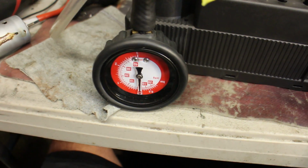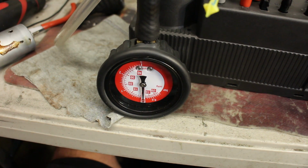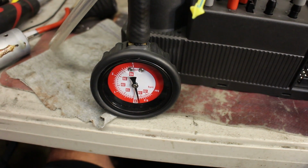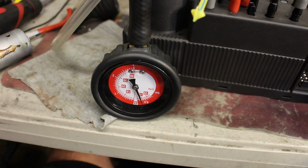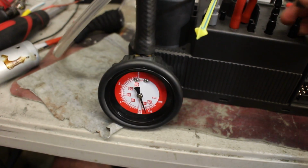So as you see, that was the pressure circuit. It pumped up pressure to push the handle out from the trunk. I'll let go of the power, and the vacuum is created to pull the handle back in. One more time. Pressure, handle is out. Vacuum, handle is in. That's good.